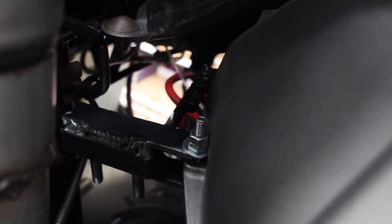I don't know if you can see it bolted in here, but there she is. So now all I have to do is mount the master cylinder, those two things, and then it'll hook up to the clutch fork. You can see I got the one mount there and then the one mount up there, and then the super reinforcement stuff and that other mount over here. So we have two areas of support. Okay, so as you can see, it's holding up really well with not that much flex. So now we're gonna take it off road.